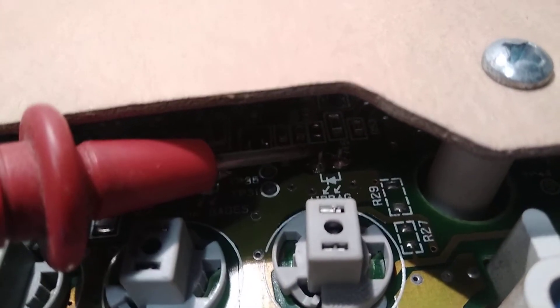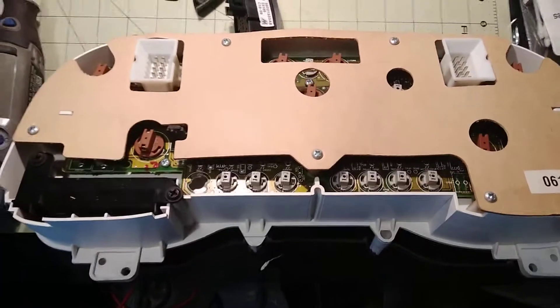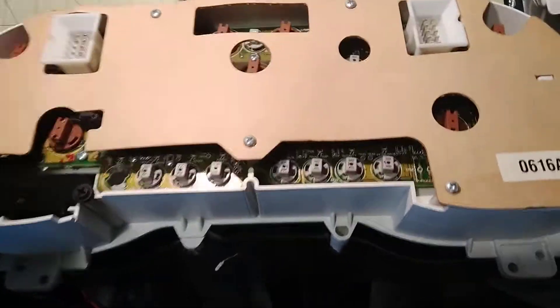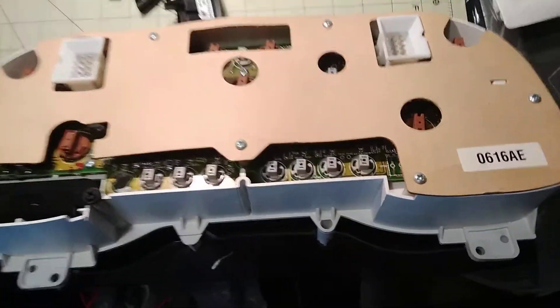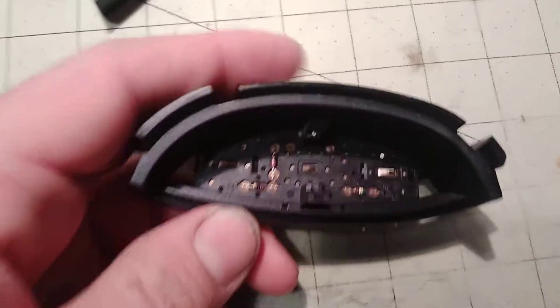Some of these are soldered in — like the airbag light, that one's soldered in. I tested all those: I took a picture, then looked on the front and compared. Some of these are empty — they don't have any light soldered in there, depending on your vehicle. I made sure the switch was working. I thought the switch wasn't working because the cruise light wasn't coming on, but the cruise light was just burned out. I got the part number for those at Napa and cleaned the cluster.